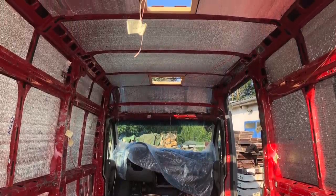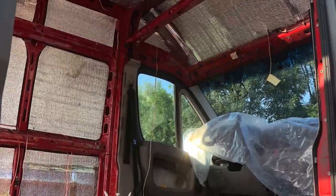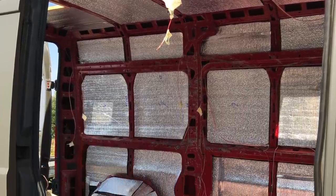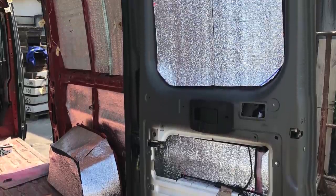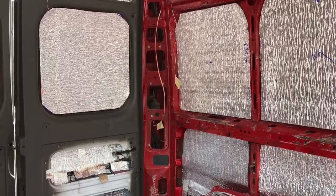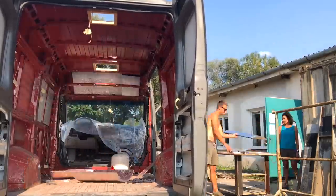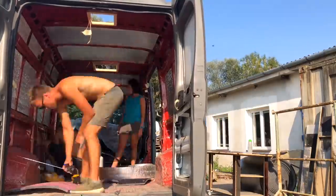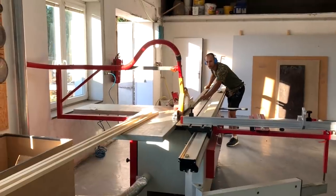Next is the insulation. There are many ways to insulate a campervan — this topic is broad and you should research it on your own. I chose silver double-layer 18mm mirror insulation. It's important to cover everything with panels and leave some air gaps. I sprayed contact glue on both surfaces — the car and the insulation — and put it on like a sticker. My friend Richie helped out: I measured, he cut shapes, and this entire phase took just a few hours. Easy.